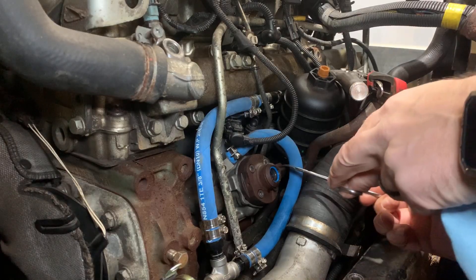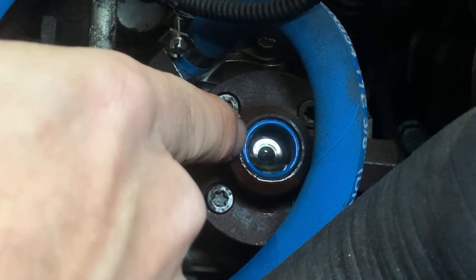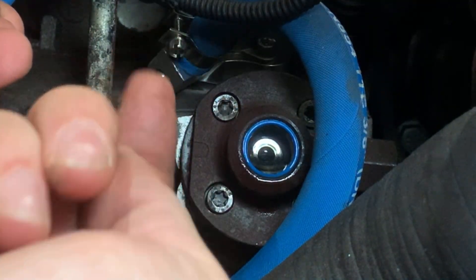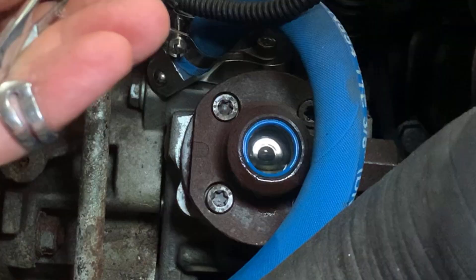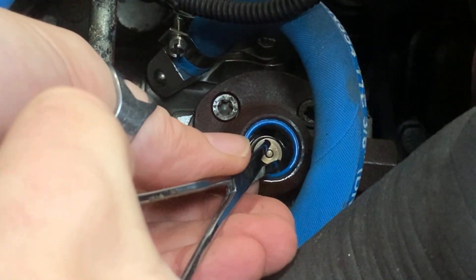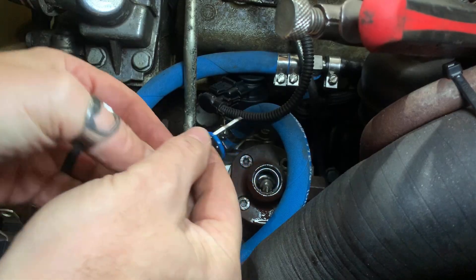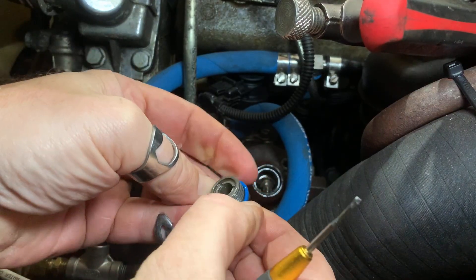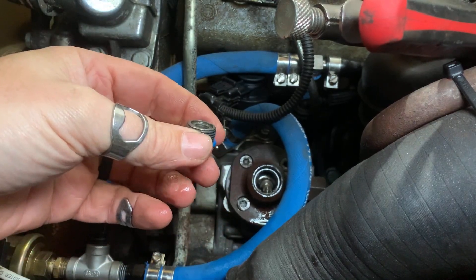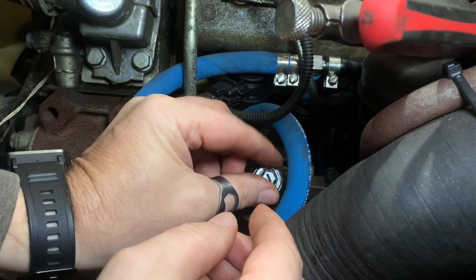We should now be able to put this back in knowing that there's fuel at the pumping element. There's a little better angle — we can see it's definitely full of fuel there. The fuel is coming from the hole at the base where the piston is underneath — it goes out this way. So as long as there's fuel on top of that piston, it should be able to push fuel out as long as it can generate pressure. If you're doing this, it's far easier to remove the o-ring and place it on the cap versus trying to thread the cap through the o-ring — this lets you get the cap into position quickly before the delivery valve drops out of place.